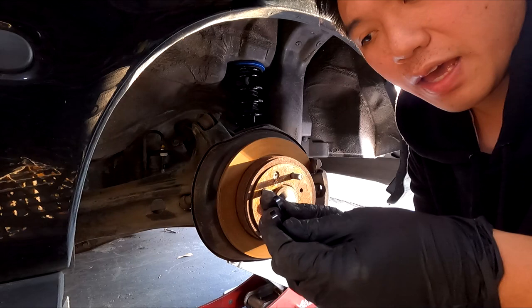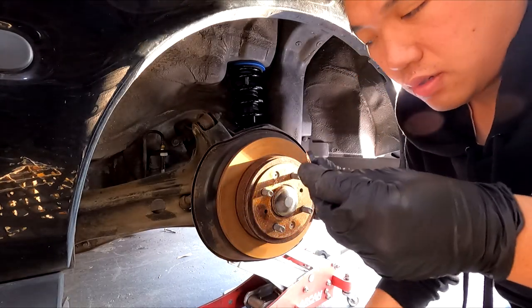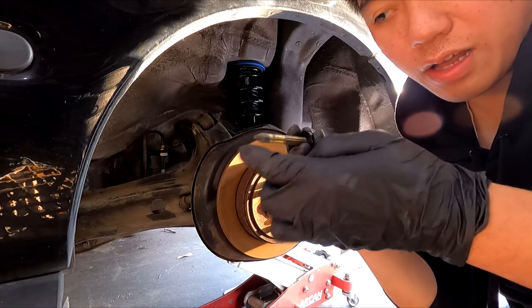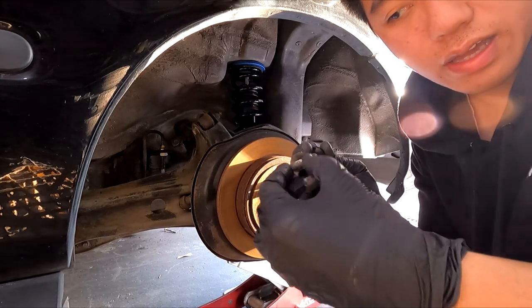Just remembering on the EK models, you've got two additional washers to add between the forks. The order is: bolt, shock, spacer, through the lower control arm, spacer, shock here on the other side of the fork, and the nut at the end.